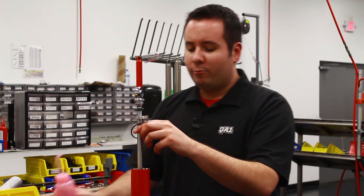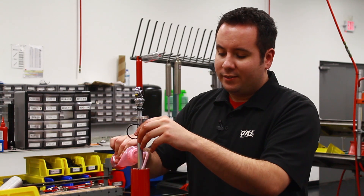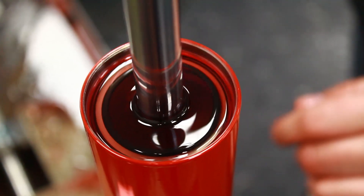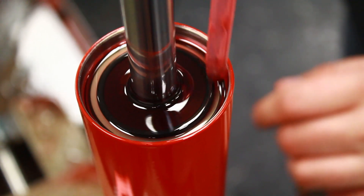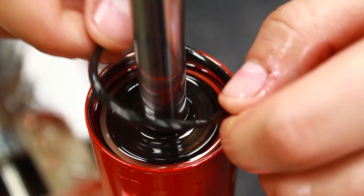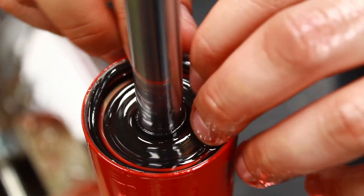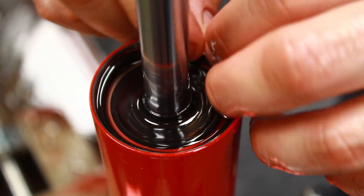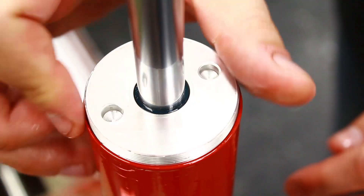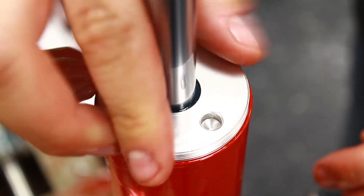At this point, if you have a rag, you can wipe the oil away and use a suction bottle to suction off the oil that's on top of the seal. Then take the closure nut o-ring and press that down into the o-ring groove. Then slide the closure nut down and tighten it up.